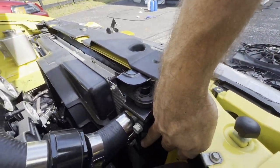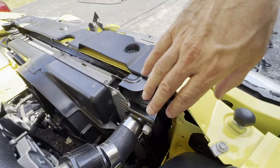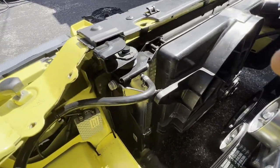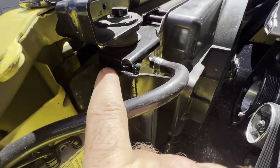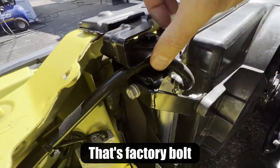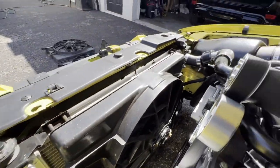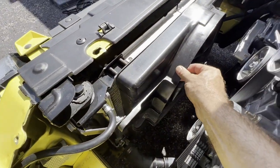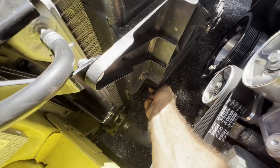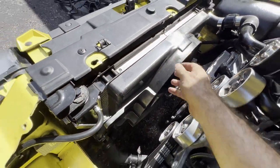This little bracket is just two inches — it's nothing more than a flat piece of metal that runs from that mount point over to an existing hole on the factory bracketry. It's a little stub about two inches long with a hole drilled on each side, with a little bend, and I was able to bolt it right up there. The driver's side is also easy but with a little more bending — there's an existing hole on the side of the factory bracketry where you put a bolt in, so the bracket bends over and comes up to that perch. It's really solid. At the bottom I have one small zip tie just to stop any resonating or vibrating.